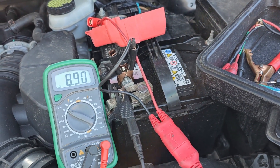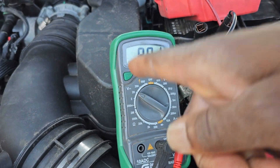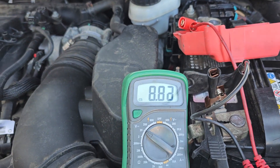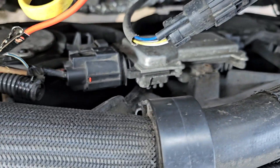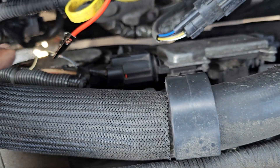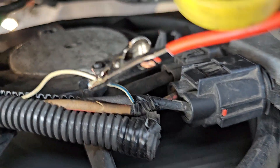Okay, I want to know how it changed. You see now the voltage pulled down from 12 to 8 — that means a command for the air conditioning, for the AC to work. You see now the two fans are working. If I cut this wire the fan would not work — that means if there is no signal between this module and the computer, the fans won't run. You can see the fans are running.